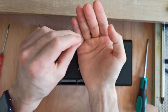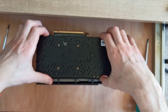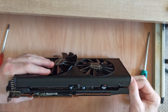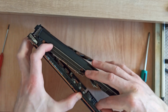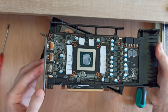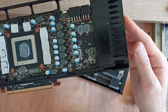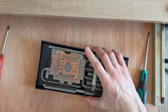I find four screws to remove. It's still not coming apart, and I can see no other way but taking the four heatsink tension screws out. They're pretty robust and standardised — it means breaking the thermal sealant, with just one wire securing the fans still connecting them. That's a lot of thermal paste. It looks like the thermal compound has bridged between the main chip and the surrounding SMD devices, but I guess it's not as conductive as people make out, because it runs fine apart from the fan.